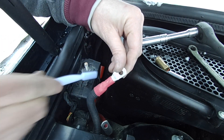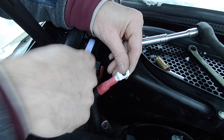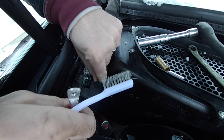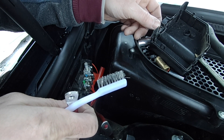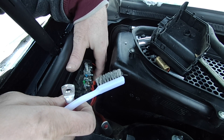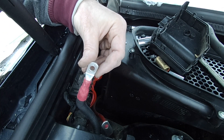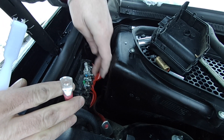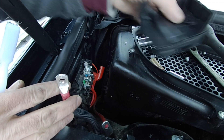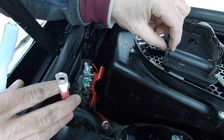We'll just clean up the stud too. There's a whole electrical box in there, so we've got some more connections down here we should definitely clean up. This is why I recommend you don't wash your engine bay — because if you were to get in here with a pressure washer and that cover was on there, see it's not sealed, you'd end up with moisture in there. And it would be a big issue, trust me.